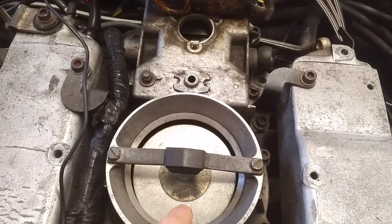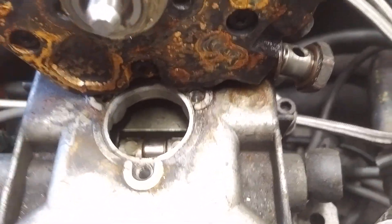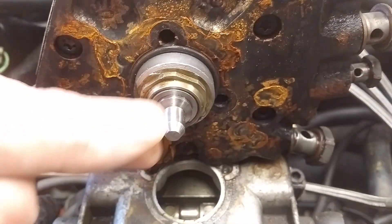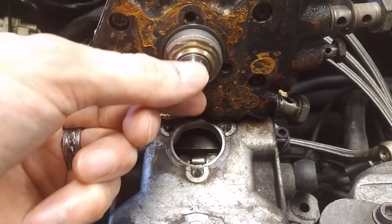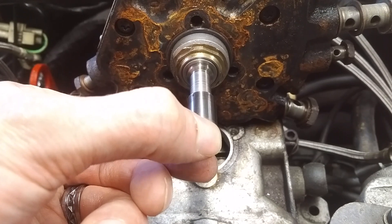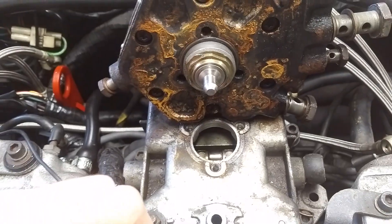So when the air pushes down on this flap, it pushes up — like a seesaw, or a teeter-totter to our American friends. And what that does is it moves this plunger up and down inside the metering head, which is the big black spider thing on the top of the engine with all the fuel hoses going to it. As it pushes this up and down, fuel is flowing around this, and this piece in the middle where it necks in — that's the fuel flowing to all the injectors, and the more this thing is pushed up the more fuel is pushed into the injectors.